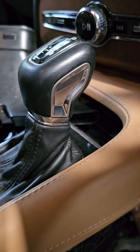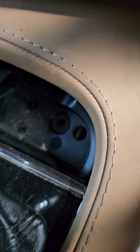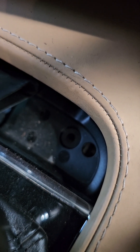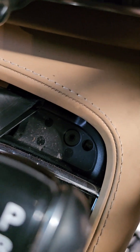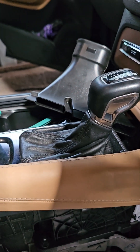You can pull this gear lever back and you'll be able to put it in neutral. There is a small access point given over here — you can actually put a thin screwdriver and press the white lever, then pull the gear knob back and you'll be able to shift the car into neutral.